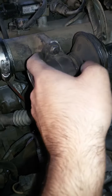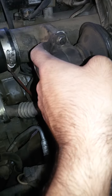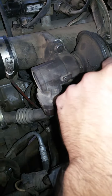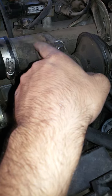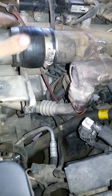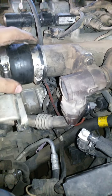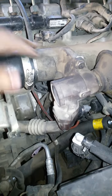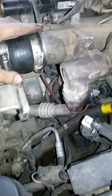Once this is removed, you'll be able to access the intake manifold from the side. This part will be clogged with soot from the exhaust gases. Use a screwdriver or a brush to get everything out of there. With the intercooler pipe removed you'll be able to access it and pull the debris out. Just scrub with the screwdriver and pull them out — that should solve the P0400 error.